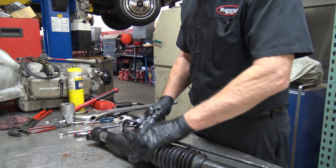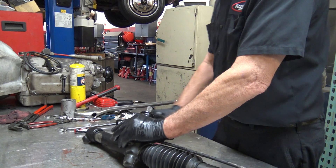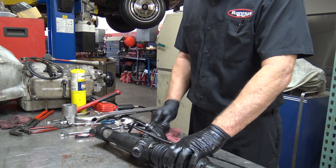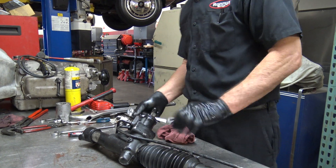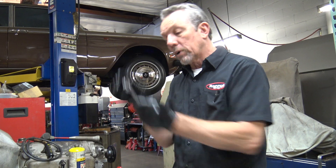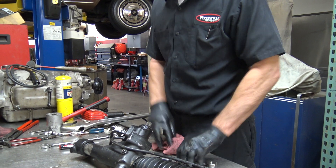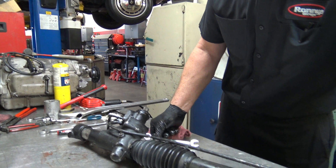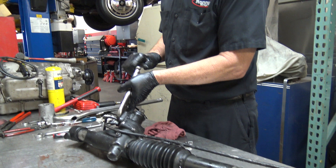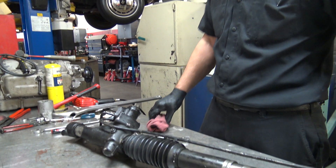You see me hit it with my hand, which I don't recommend — if you're going to do it, at least use a rag. But sometimes that little jarring effect knocks them loose. If they don't come loose and they just round, you've got two problems: this right here is open so it's going to spread, and this part right here is not solid — it's hollow on the inside so it's going to squeeze in. If you get one that's stuck, sometimes you can just clamp it really good with one of these and then hit it with a hammer to knock it loose, if you have access.